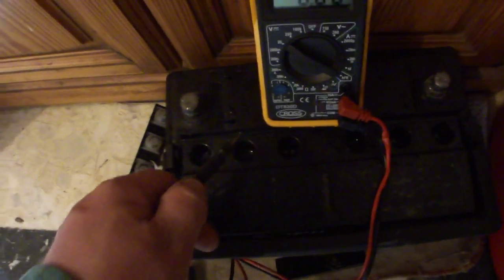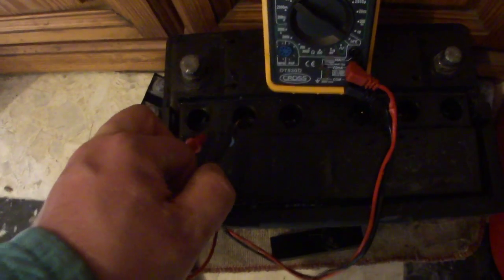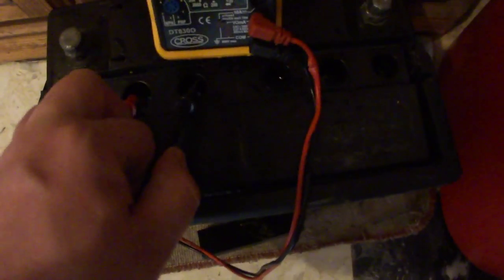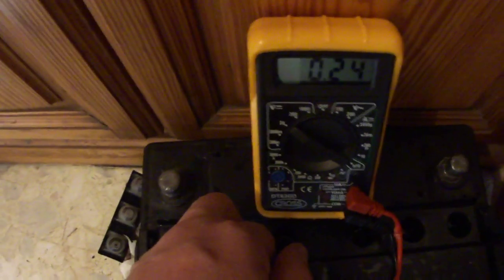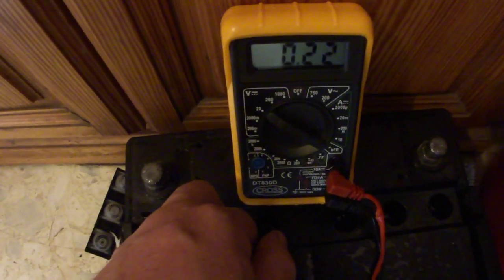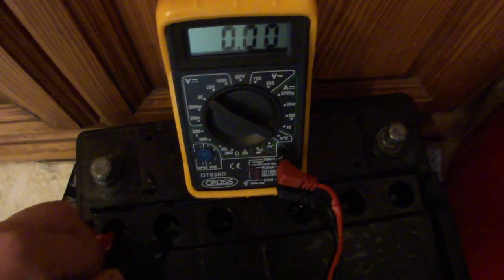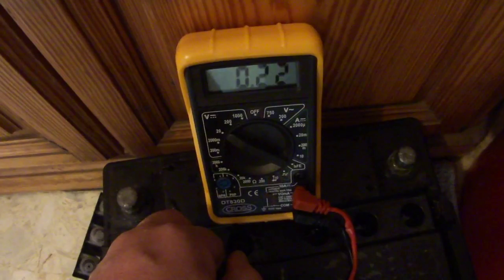Finally, we have seen that this battery might have two broken cells. I just tested by putting the meter probes into the water bars, or the electrolyte bars that you see here. This cell has only 0.22 volts of charging; the first one has 1.99, so the second cell has some kind of short circuit.